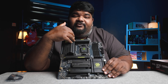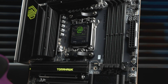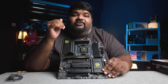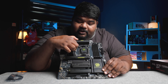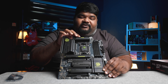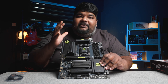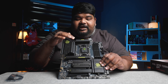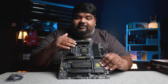Let me start off with the VRM configuration for this motherboard. This motherboard comes with a 17-phase VRM configuration and 80 amps of smart power stages. You can actually see that the motherboard's VRM are down here, just like any other motherboard. However, take note of the size of the heatsinks — I find them a little bigger and wider than usual. So if you're actually installing it into a compact case, take note, you might have a little bit of difficulties.